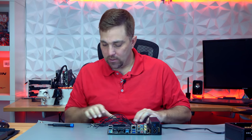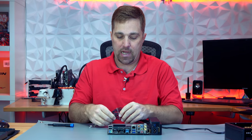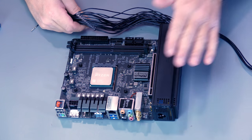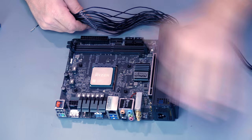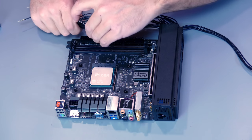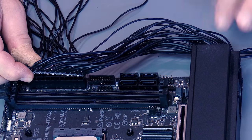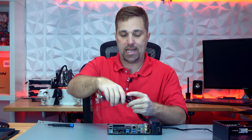I got all the cables pulled from the cable housing. And since I can slide the comb along wires, exactly how it's intended, I can get a more precise measurement on exactly where I want to cut my wires. I have the motherboard and power supply set up exactly like it is in the case — everything fits very compactly. I'm going to use my cable comb to measure the length. Right about there should be good — that gives me some slack. I don't want it to be completely tight, but I can still get rid of a lot of wire.